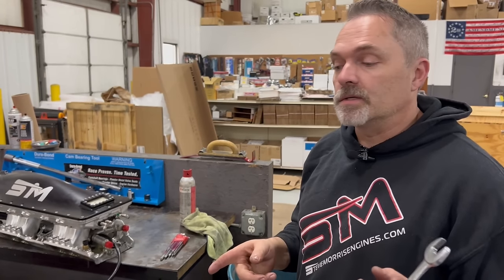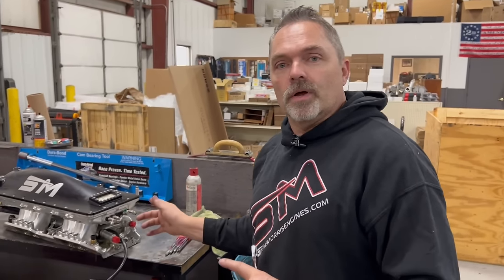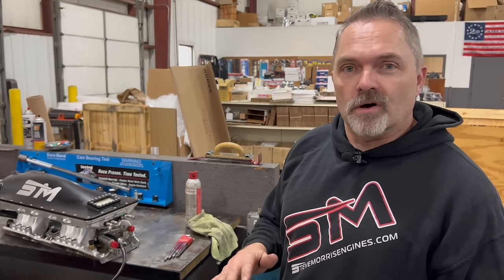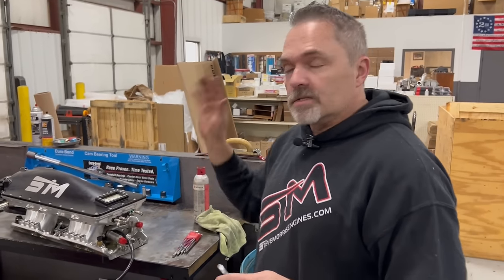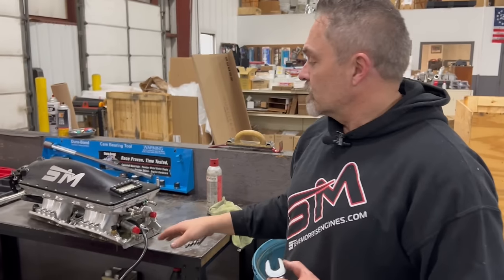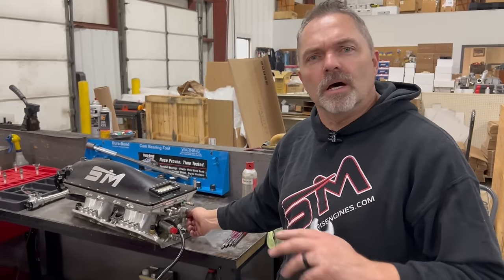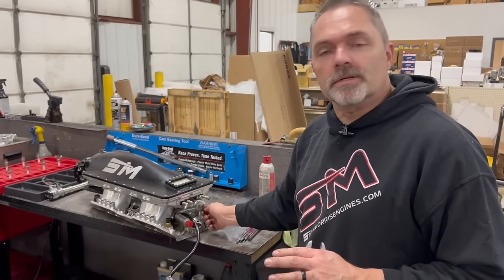What that really does is, you can do it all on methanol. I do it all on methanol in my car. Other cars will do it that way. But one good thing it does is it keeps the oil clean, because the oil gets really contaminated by methanol idling, not going down track, idling. So when these things are just cruising up to the starting line, cruising all the way back in particular, it does a nice job of keeping the oil clean and less contaminated. It makes for a little bit simpler, easier, probably better setup. It's a little hard to do on everything, but possibly a little bit nicer.